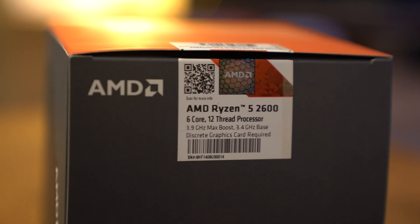Alrighty guys, I'm back and I've gone ahead and replaced the thermal paste on the CPU — it's the Ryzen 5 2600. Just wanted to also mention there is a slight overclock on this chip; I've got it running at 4 GHz on all 6 cores, 12 threads. As far as temperatures, what we were looking at before on the CPU diode under full load in HWINFO64, we got about 82 degrees Celsius.